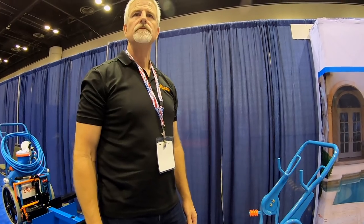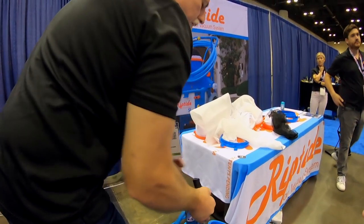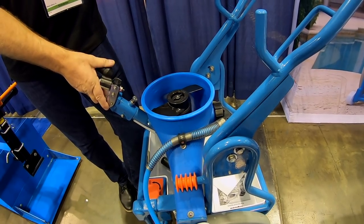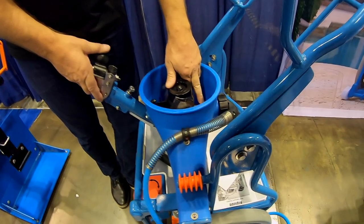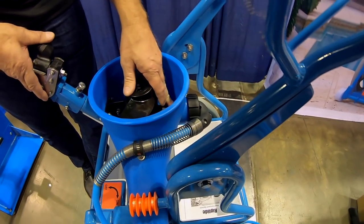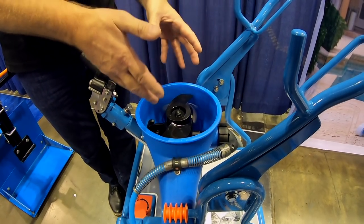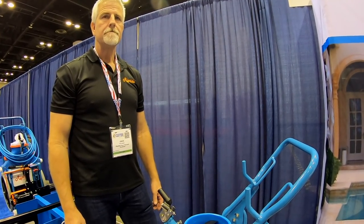And I think a big replaceable part you guys are able to do are the motors. That's the biggest complaint I hear with other systems. They have to send it, and their cleaner's down for 3 weeks because they're waiting to get it resoldered and everything. When we came out with this, because we're selling across the world at this point, we wanted to be sure everybody can do their own maintenance. So we developed this specifically so that the cord separates from the motor right here. You unscrew the through bulkhead fitting here, you unscrew this fitting here, and it unplugs. Two bolts on the bottom, one bolt right here, and the motor slides out the top. Drop a new motor in, put the bolts back in, you can literally change this motor in somewhere around 10 minutes. That's huge. Absolutely. So guys, you're down 10 minutes versus 3 weeks.